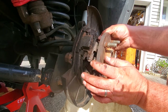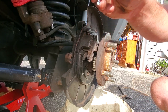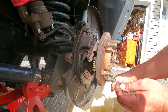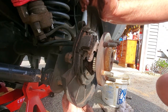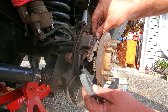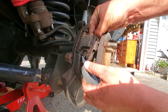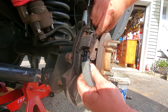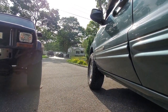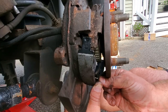I got my backing plate assembly pretty much as clean as it's going to be. Let's slide out these old pins - don't need them - and slide the new ones in. They go right from the inside out. All right, pins are in. Let's try this top shoe first - it's a little bit different than the XJ ZJ parking brake levers but I can figure this one out.